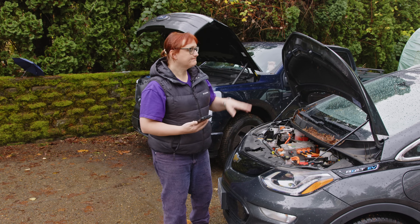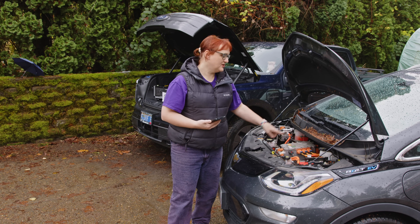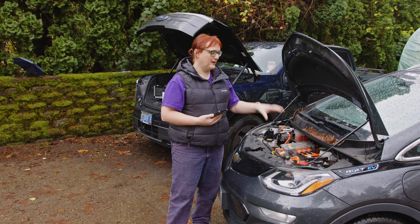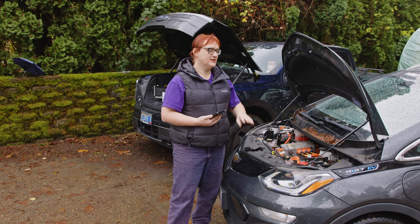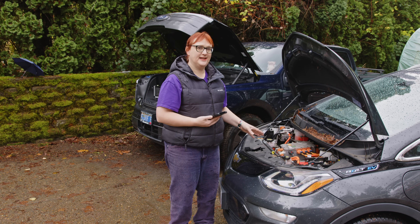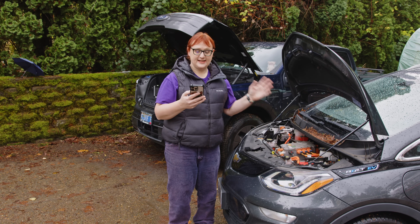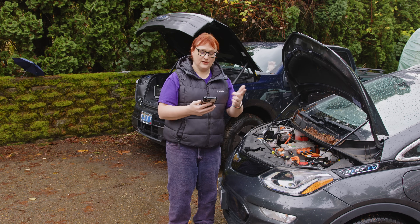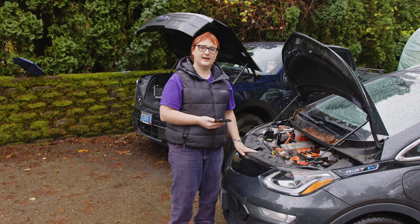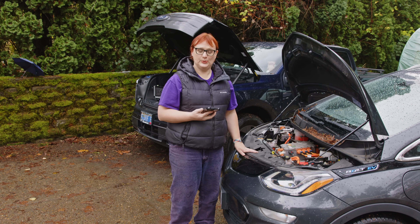The temperature of the battery is going up, but importantly, the car didn't show any error messages because of that little trick I did. I don't need to worry about that with the truck, but for the Bolt it allowed me to put a new battery in without losing any of my vehicle settings and without upsetting anything. So far so good — it seems to be doing fine, no errors. I'm just going to keep an eye on it over the next couple of days to make sure it's happy, and every time I get in my car I'll just fire up the app and see what's what.